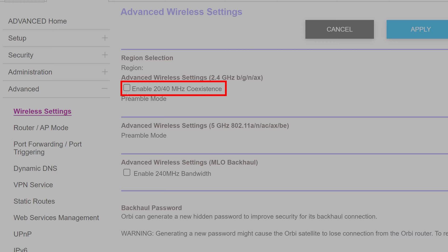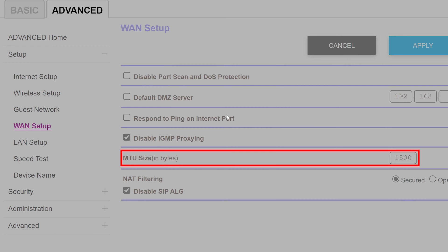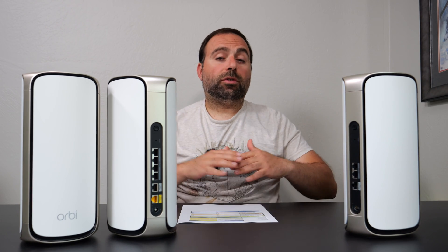In those two weeks, something surprising happened — it actually dropped a connection a couple of times. The first time, I restarted the system and checked my ONT — which is basically a modem for people with fiber optic, standing for Optical Network Terminal. The ONT had been stable, so it likely wasn't the issue. The problem came back two or three days later with another drop. It did fix itself, but it surprised me. After digging online, I found two options: disabling the 'enable 20 to 40 MHz coexistence' setting, and changing the MTU — it was set to 1508, so I changed it to 1500. After that, there were no more drops over the following week. Hopefully that fixed it, or a firmware update will address the issue.